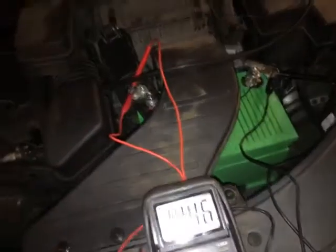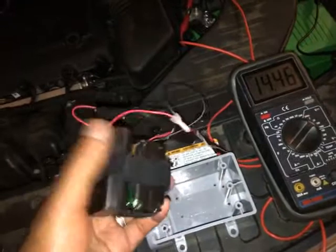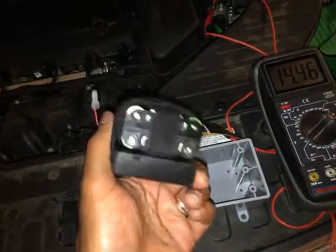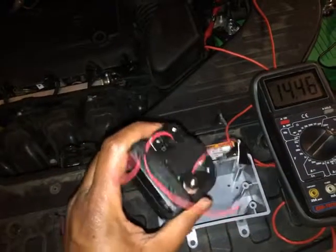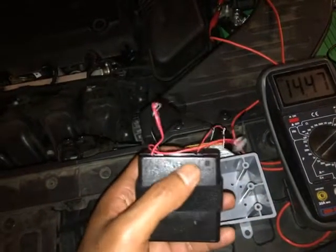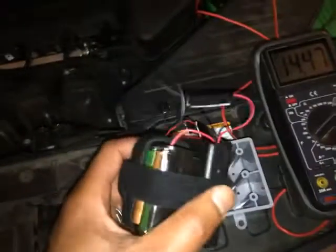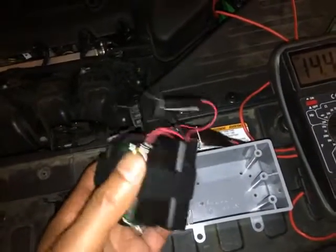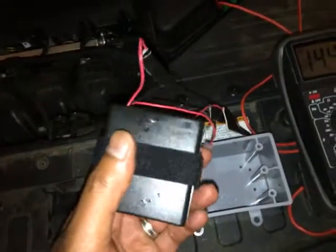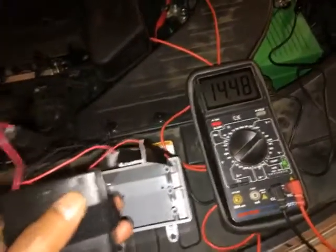Taking a cue from Laser Saber and a few others, I built my own battery pack. This battery pack is not lithium-ion — I used some old spare parts I had. These are just some battery holders, and this one has an on/off switch. These are just rechargeable AA batteries connected in series, coming up to about 15 volts.